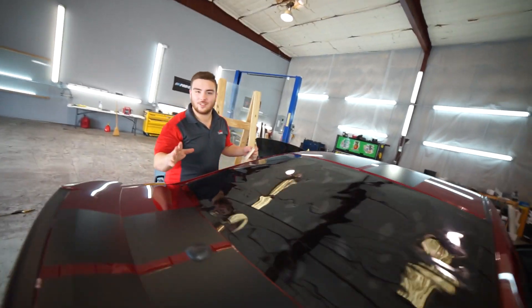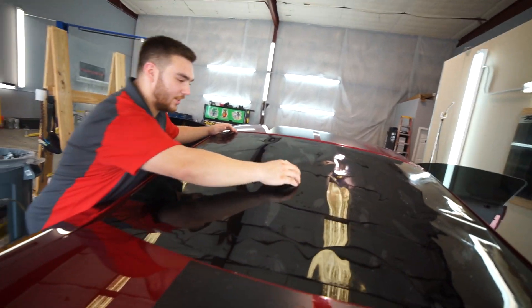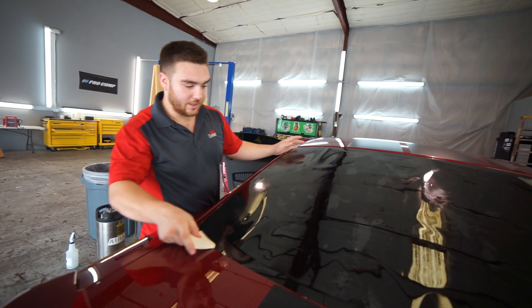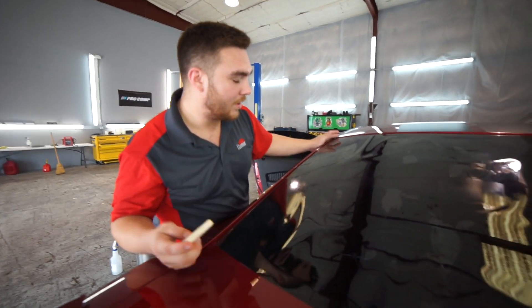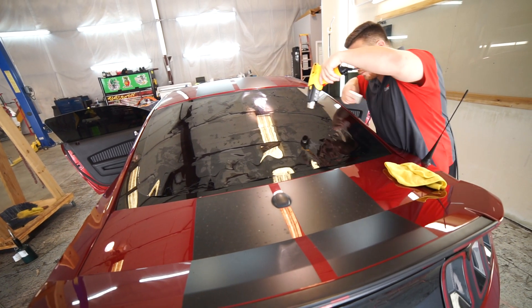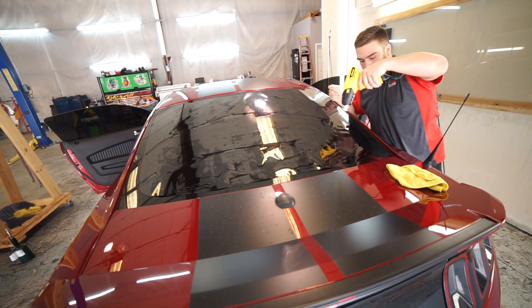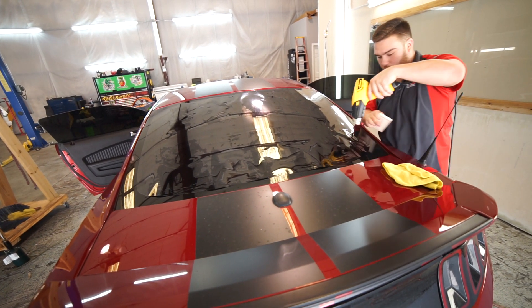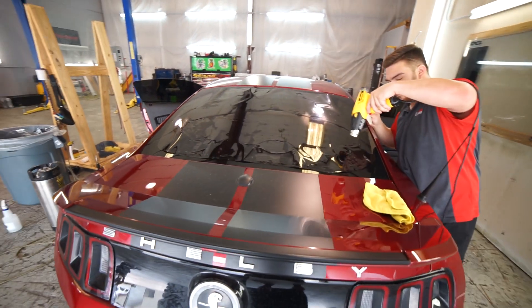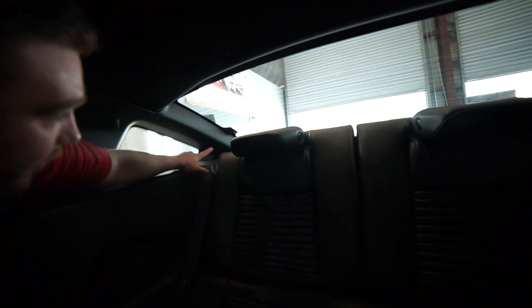So now, I know what you're all thinking. The tint does not go on the outside. This is just part of the preparation to put it on the inside. You gotta shrink it to form to the curvature, put some heat, and you're good to go. You just do it right there? You don't even need to pull the seat up? I just unplug those defrosts so they're not in my way. Maybe take out these headrests. If not, no big deal, we'll get it down.